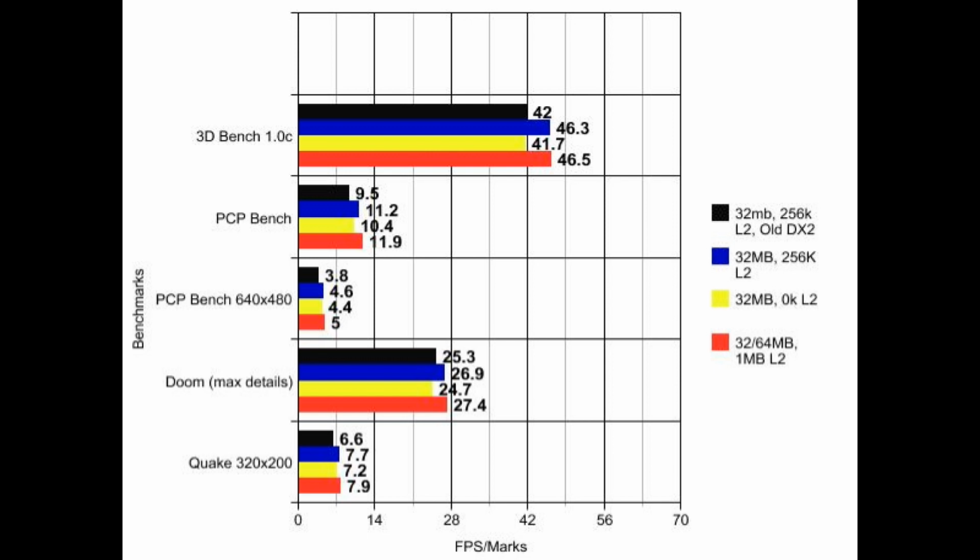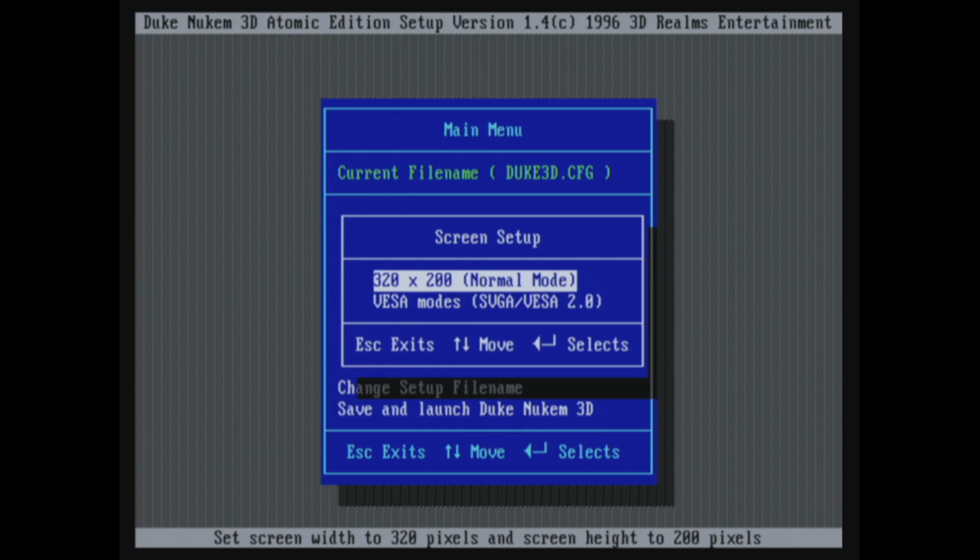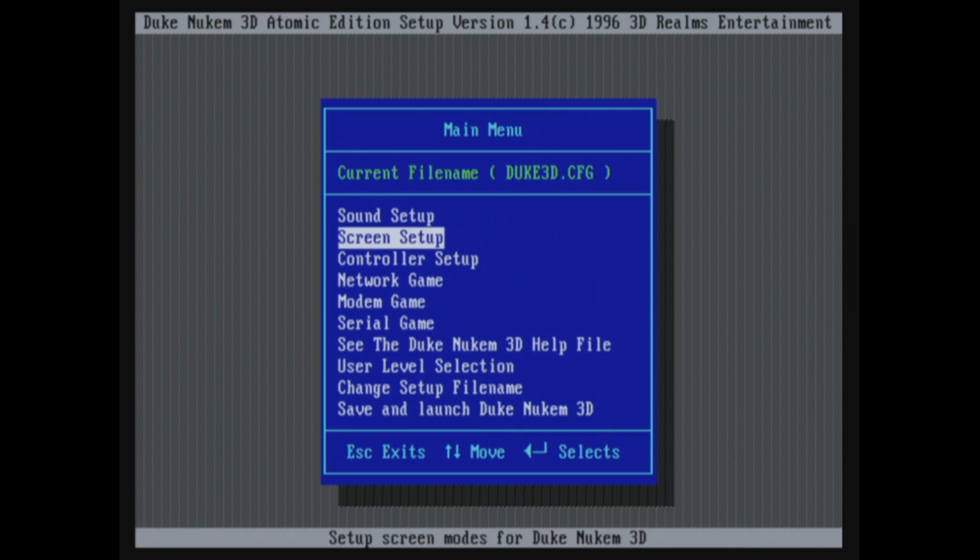All right, so there is our DX2 enhanced CPU in there. Now I am going to put on a little heat sink and fan on this guy. It doesn't create a tremendous amount of heat. I have opened up machines with 486s that have been running for years and still being reliable that just had bare 486s. No heat sink, no fan, nothing. And they still worked. So you can do it. I don't recommend it. So I'm gonna slap this guy on there and continue with our build.